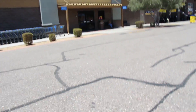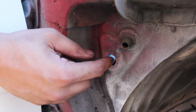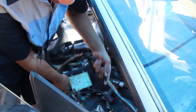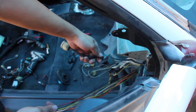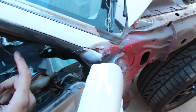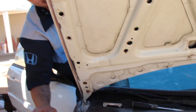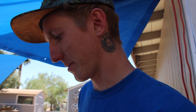So we've got to drill this hole so we can feed the headlight harnesses through, the fan switches through, and the blinkers and everything. And you've got to separate the engine harness — where the engine plugs in — separate that from the wiper plug, then feed the engine harness back through and have it come out through this hole down here. The wiper is going to plug in right there, and then we'll have the engine harness connectors down here. That's it for this side.